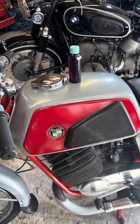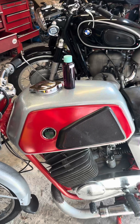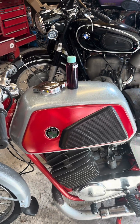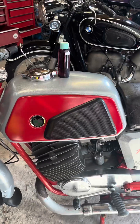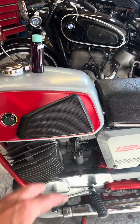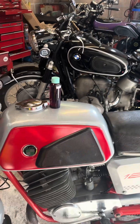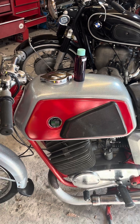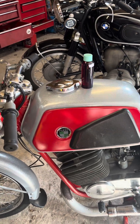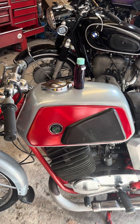I proposed my earlier post and a couple of people have asked me what pre-mix is. This is obvious to an old bloke like me, but maybe not to some of you younger guys. A two-stroke engine, which this one is, doesn't have a sump full of engine oil to lubricate it — you mix oil in with the petrol, and that's how two-strokes work.